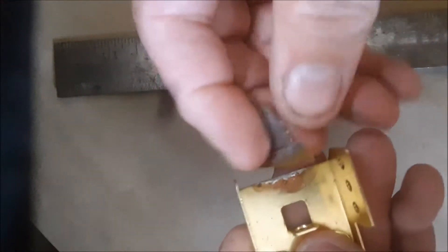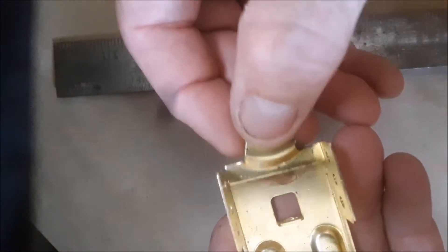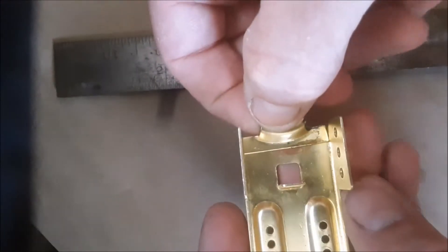I'll go through and redo that. I'll tin this piece and tin this piece, which means you'll have a light coating of solder on it — kind of like what they had wiped off all over the place. You just need a very little drop of solder; you don't need much at all. Solder is very strong if you're soldering correctly.